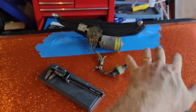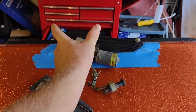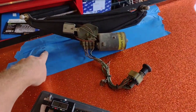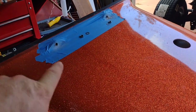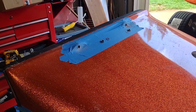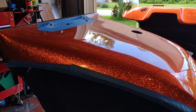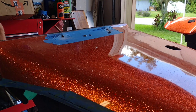The nubs may not come in the center of your dash — they may come out a little to the side, depending on the brand. I've heard that early model wipers are closer together, so that all plays into this. We're going to drill the holes and hopefully I didn't make a mistake. We got the holes drilled and had to move them in just a touch — that's why we measure twice, cut once. It should be pretty close.